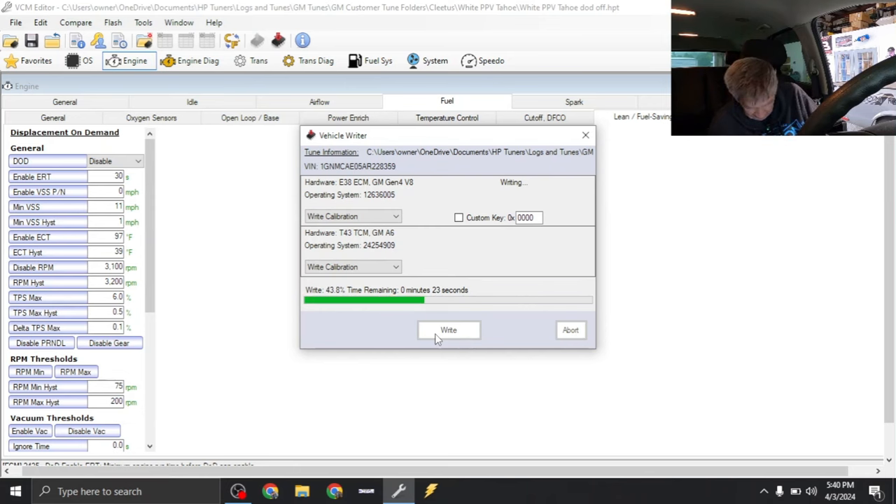And there's also a cold engine rev limiter. You know how Garrett likes to do cold revs? Should we let him do cold revs on this one? Let's do it — if the engine goes out, he'll get another one. Go over to Cold Engine. Right now when you first start it, it's got to be running for more than five seconds to get to 6,000 RPM. So we're going to go ahead and make this whole table 6,000. If we want to highlight the entire table, click that little box just above the axis — that actually highlights everything. Type in 6,000 and then hit enter or click away. You'll see the change that's made.